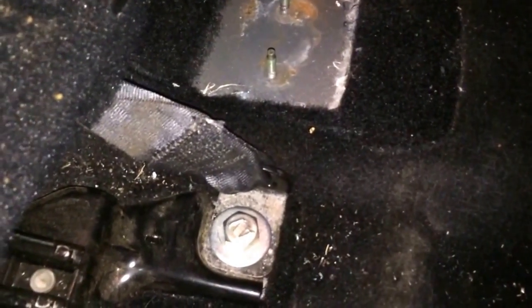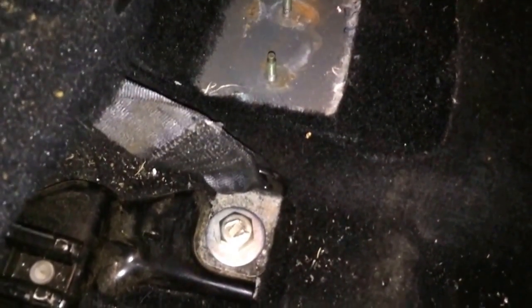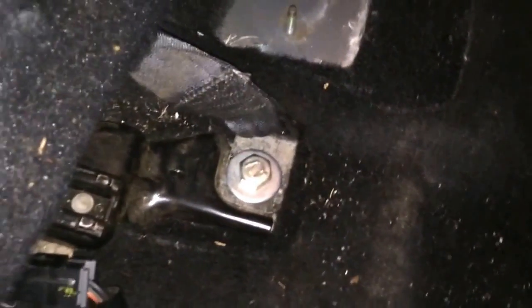We ended up having to actually drill it out. And when we did that, we boogered up the part that it screwed into. So we just removed that completely. There were just some tack welds underneath the Blazer. And we disconnected it and just used a nice stainless steel bolt to take care of that. So that was it for the problems. I showed you where all the bolts are that need to be changed. That was all the same.